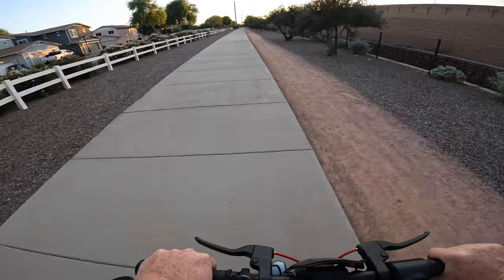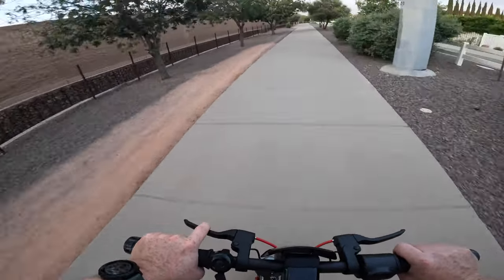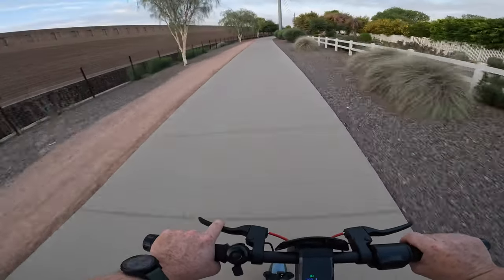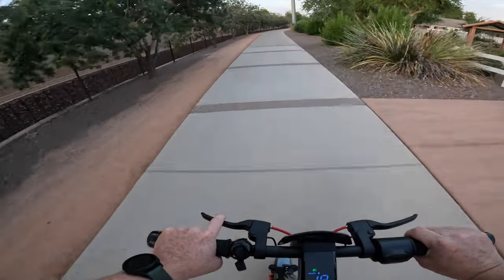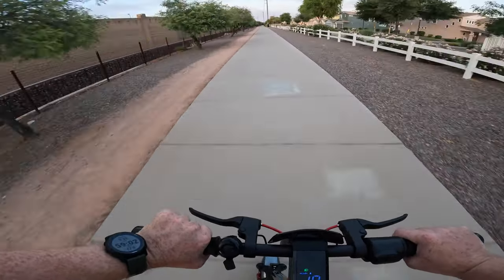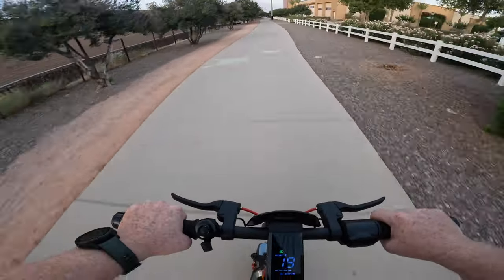As I mentioned before, this is just one in a series of videos. We're going to do a range test and of course take this up to South Mountain Regional Park to test the hill climb ability — nine and a half miles of almost continuous uphill riding, which I consider the ultimate scooter test because it tests the scooter's endurance and ability to maintain speed and temperature. We are currently at four bars out of five remaining; we've been cruising for about an hour and we're about nine and a quarter miles into this ride. One thing you really want to watch out for in this desert climate is controller temperature, motor temperature, and potential overheating scenarios.